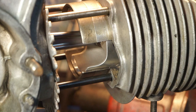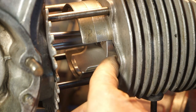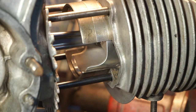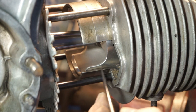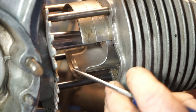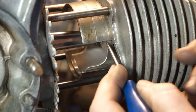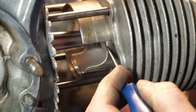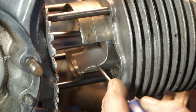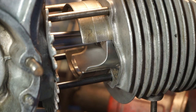Right, here's our piston position on bottom dead center. That is where it is. I've lifted it up and positioned it so we can get the piston exactly where it's going to sit at bottom dead center. So now you can see that the skirt here overlaps the skirt on our barrel. Now the skirt on my barrel is matched to the casing. So that is now obstructing flow. And this part of the skirt is also obstructing some flow. We need to profile that so it aids flow into the port, and we need to cut this back. So therefore we're increasing flow velocity into our transfer port.